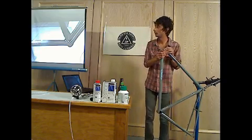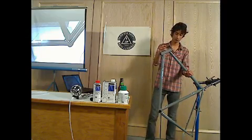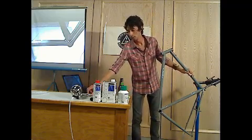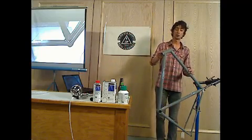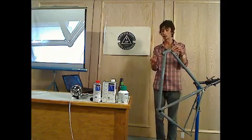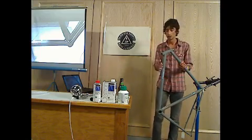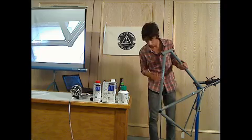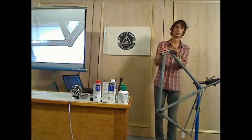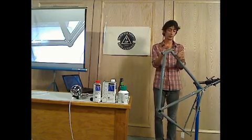That would be a little buffer. Usually there are little buffing guns with the same kind of air fittings as this, and they just run off a compressor. After this was cleared, I would look for all the little imperfections, whether indentations from fisheyes in the clear, which happen when dust occurs a lot, which hasn't happened much for me, or raised surfaces, usually little flecks of clear that just happen. You can kind of minimize it.